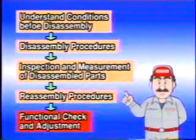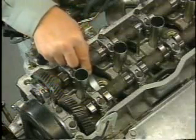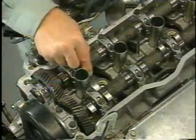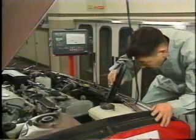After engine reassembly, each part must be checked for normal function using an appropriate gauge or tester and adjusted if necessary according to the maintenance standards in the relevant repair manual. This checking and adjustment must be carried out after assembling each engine, not after assembling all the engines.